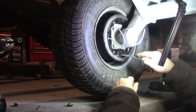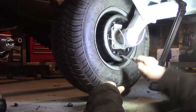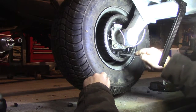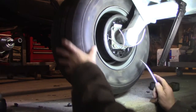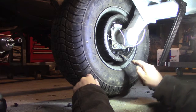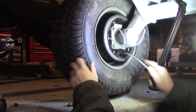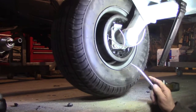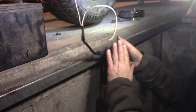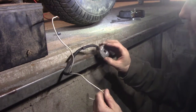Alright, it turns out I was going up, not down. I kept going up and went a little more. That might be where I need to be — let me give it another couple turns. Yeah, it's locking up now so I'll go back down. I just want drag on there where it almost spins freely. That's about what I want. I was always curious how these electric brakes worked — you apply voltage to it and it becomes a magnet.